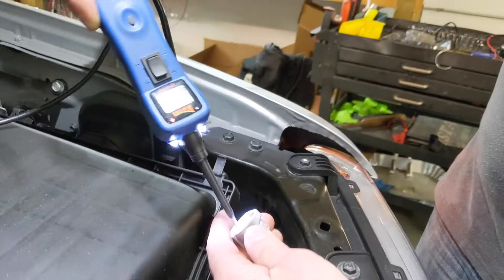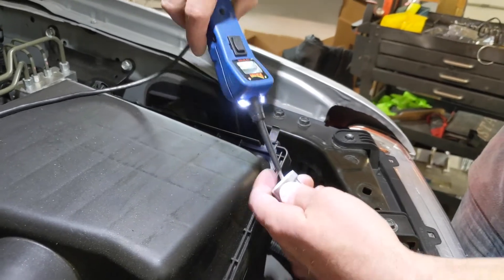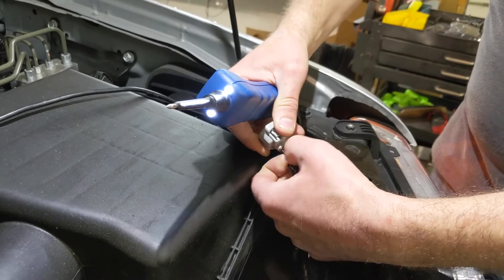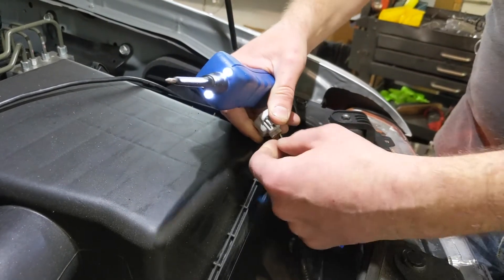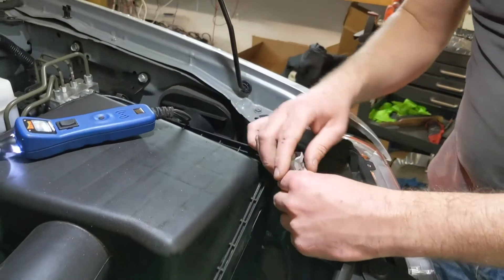We can confirm it by putting it on the red wire — that's the parking light. So we know we need to install one of those resistors between this black wire and this green wire. We're going to strip this back a little bit and create a plug for it and show you how that's done.